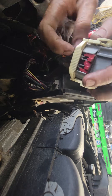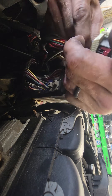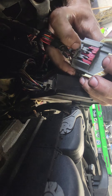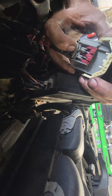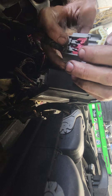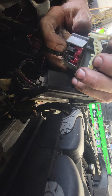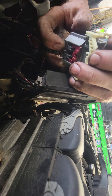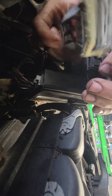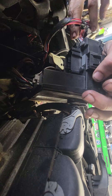You're going to push up on this and wiggle the connector at the same time and it'll release just fine. If you just press the button and then release the tab, as you can see it gets caught in there — it'll actually break the connector. So basically: push down on this tab, lift it up until it gets about halfway, then wiggle it out and push up on this at the same time, and then keep that good and clear.